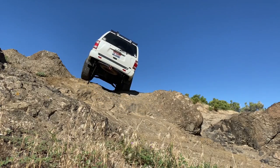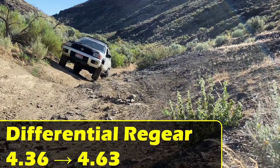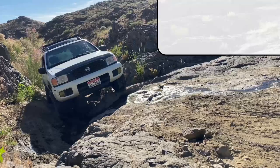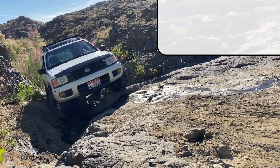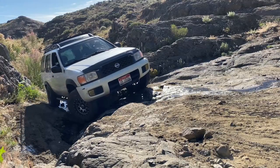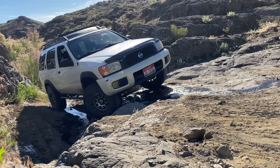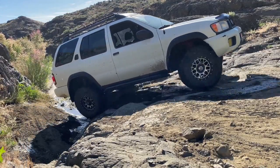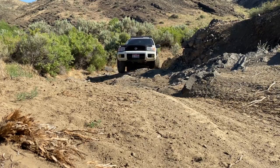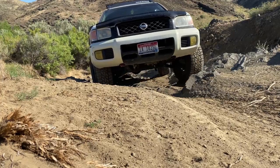Any 2003 or 2004 R50 will have 4.36 gears. So I re-geared my R50 from 4.36 to 4.63 to handle those 32-inch tires and any other weight I'm adding to the vehicle. My RPMs went up but it shifts better. My front diff is now from a 1996 R50 to get those 4.63s, and I've got a Front Lock auto locker in it - that thing is a beast and totally changed my traction game off-road. Since I've got those manual hubs disconnecting, I don't have any problems with it on the road because I leave the hubs unlocked. The rear limited slip I got off a 2000 Xterra - it's a 4.63 LSD with factory breakaway torque of 140 to 180 foot-pounds, which is twice as strong as any factory R50 LSD.